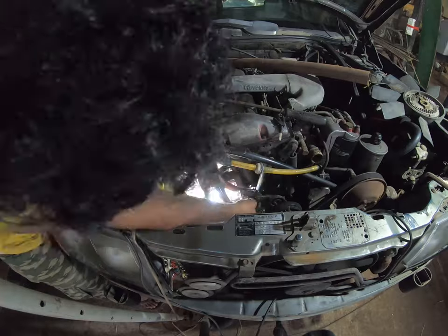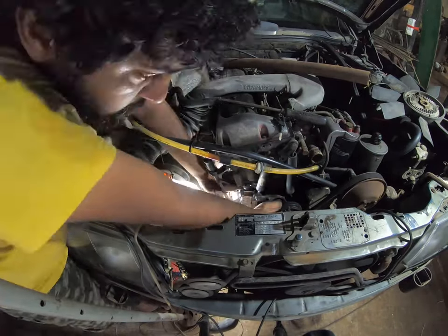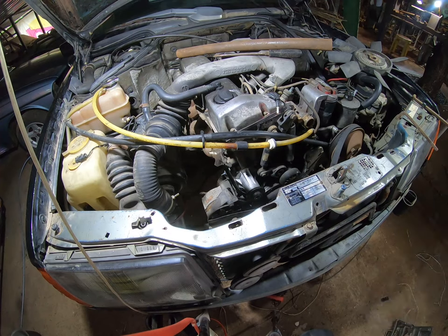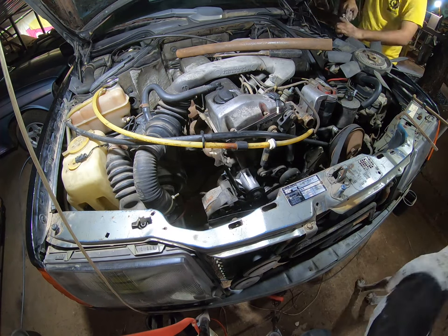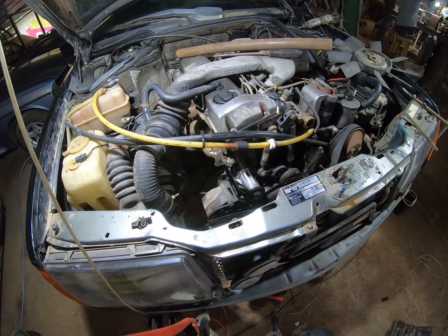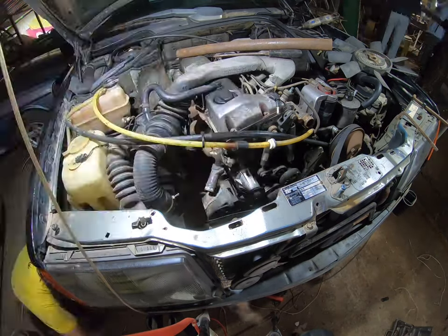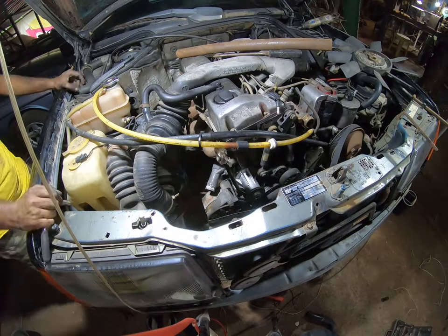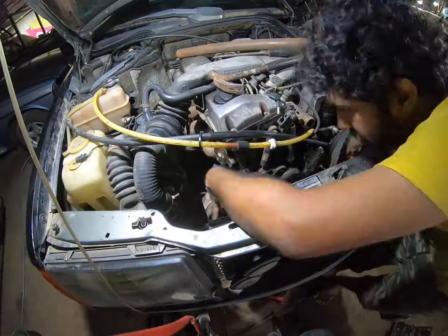After that, I move to the side, remove the thermostat housing, and begin cleaning the mating surfaces. This is important to prevent fluid leaks as there could be debris stuck in the metal. I then fit the new water pump with its paper gasket and replace the thermostat housing with a new valve after a bit of cleaning. I seal the thermostat housing using a liquid gasket maker.